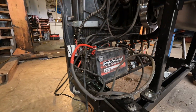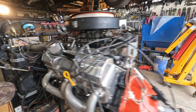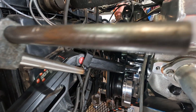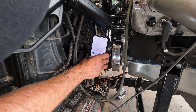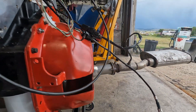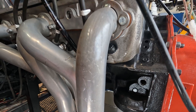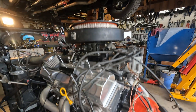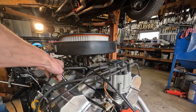That'll come back — off to the bottom of the water pump. That rad hose is leaking. I don't think I got that clamp on there terribly good. Right there at that clamp — yeah, it does look like it. Yeah, so it's leaking out of the neck of the pump. It looks like I'm also leaking out of the valve cover here. This thing always leaks. These fabricated covers are better than the others — they just use gaskets, that's why they changed that design.